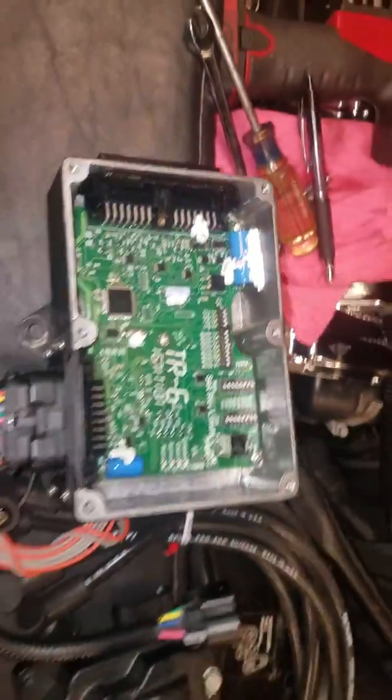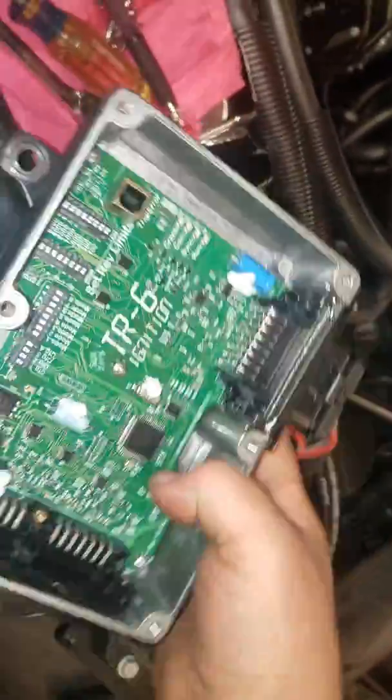Okay, you also have to upgrade the fuse under the dash on the CCCI model, which if you look up there, it's a 10. I've already replaced it with a 25 amp. There's the 10 that's come out of it. Other than that, this installs just like the factory module. It's going to plug in and bolt up just like the factory module.